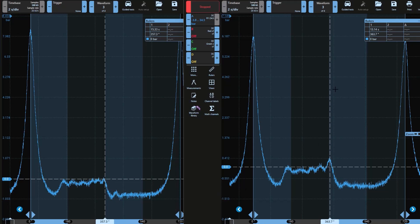If we go to cylinder three, we can see the same sort of setup, but if we look at our zero line, there's a little hike of pressure there, and then our intake valve starts to open. Look at that number at the bottom — 363 roughly degrees. The known good is about 357 over on the left. We thought there was an issue going on with this intake valve. That was enough for us to go to the customer and say we really need to take this rocker cover off and have a look.